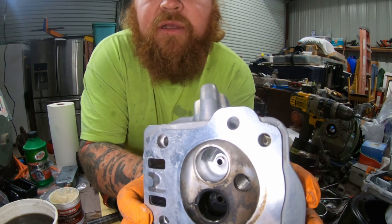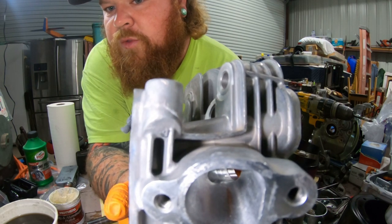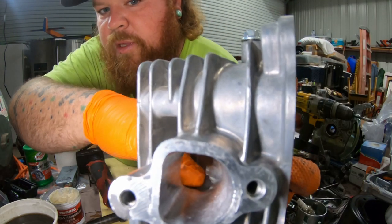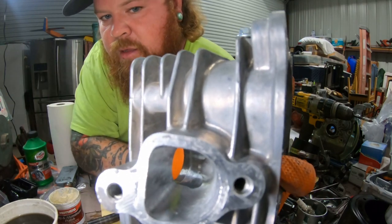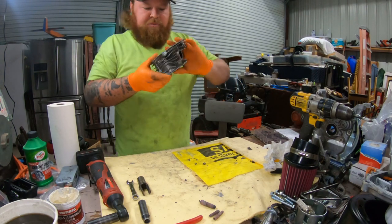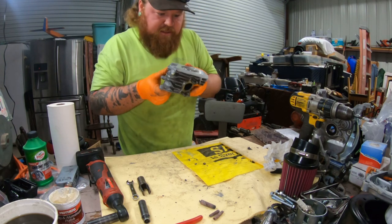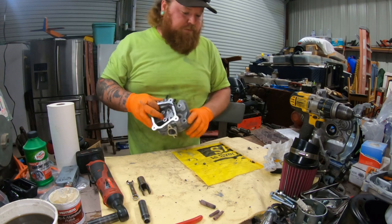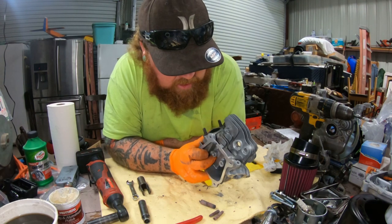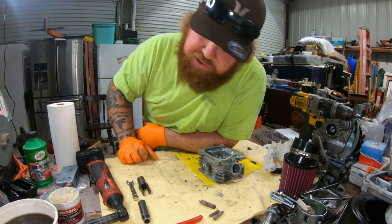See how shiny it is in there now and smooth - it's smooth all the way to the back and there's no humps. Right here was a huge hump, now smooth right in there. I think I'm going to call it good on the intake side - it's smooth, there's no humps, there's no nothing, it transitions right into there really nice. So now we're going to do the exact same thing - just kind of smooth out the exhaust side a little bit. When the valve opens, no restrictions, that sucker's out of there.